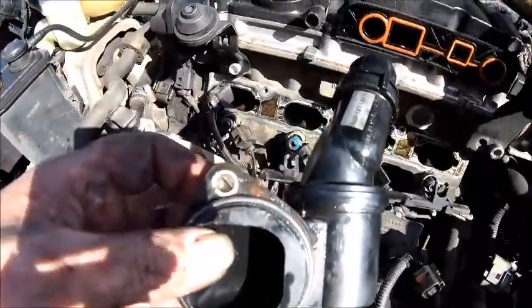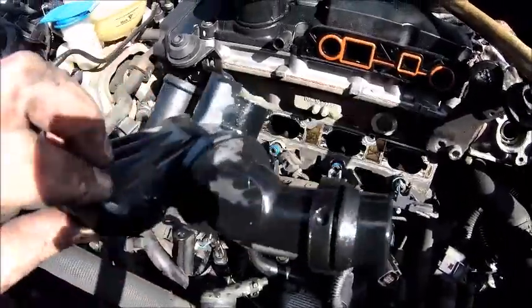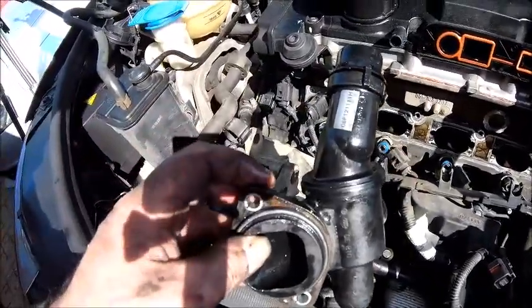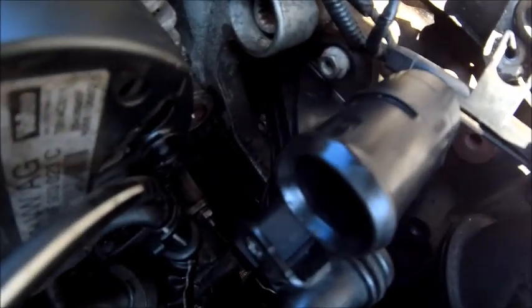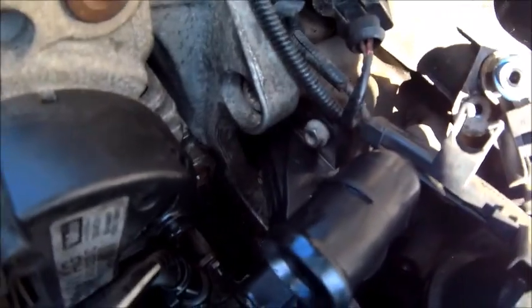So if you think you're doing this yourself, if you've got a good mechanic who doesn't charge much, take it to him. Oh my word, there you go. That's the thermostat, right. Definitely a break and definitely time to have a coffee. So I've got the new one in place, just the unenviable task now of getting the bolts in without pinching the seal behind it. So yeah, two hands needed. Catch you in a minute.